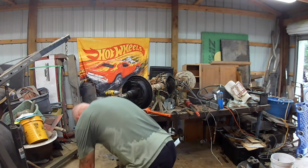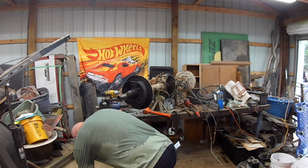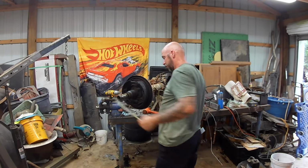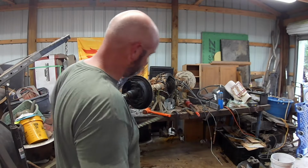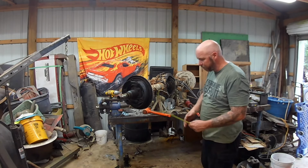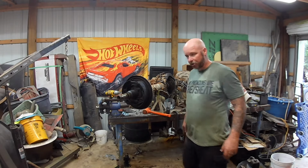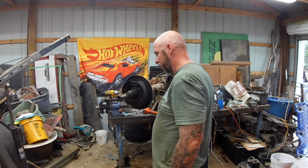3.5. 13. When you're ordering brake parts, especially for old trucks, there's probably 2 or 3 different choices. So that's why I'm measuring. We got 13 by 3.5. I probably should pull the other drum off, but I'm not gonna, because I want to go get some dinner. So we'll do that, order some parts. Maybe I'll come back out later.